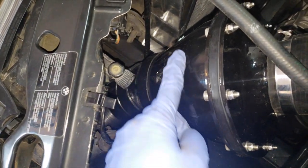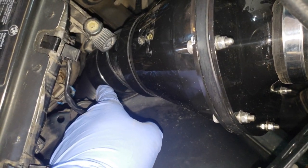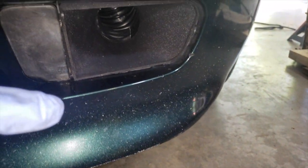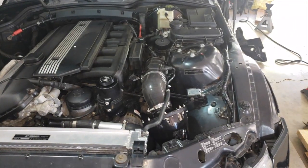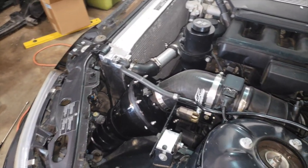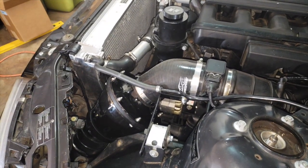Down here you can see again the Apollo intake system, down into the aftermarket 3-inch tube, headlight reinstalled, and again down to the 3D printed nylon 12 intake duct right here. Now that's basically it, except for firing it up, seeing how it sounds, testing it out, collecting and analyzing some data from the intake temperature sensor via OBD2. But yeah, let's give this a go, see how it sounds.